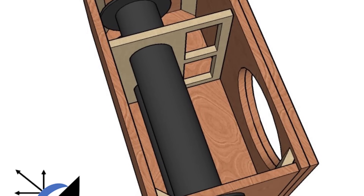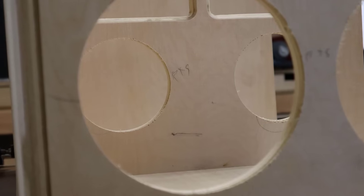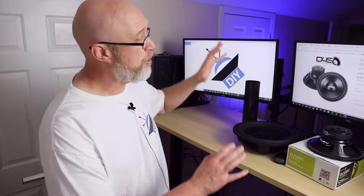For people who don't want to go through the extra expense of upgrading the electrical system, you have to follow Hoffman's Iron Law. That's why when I design a subwoofer enclosure, I typically design it a little bigger than the manufacturer recommends — because Dr. Hoffman is smarter than I am, and he's probably smarter than you too. There is a limit to how large you can make an enclosure: the air inside acts as part of the subwoofer's suspension, and as the enclosure gets larger that air suspension gets weaker. If the box is too large, the suspension can no longer control cone movement and you'll get distortion. I like to model that in WinISD.